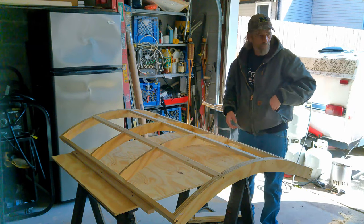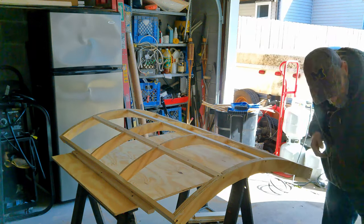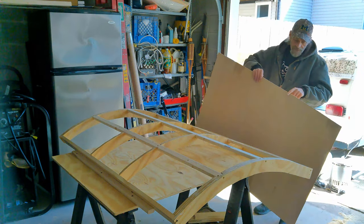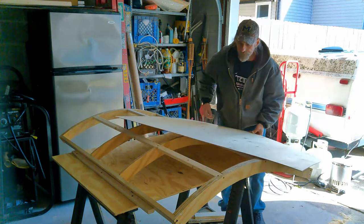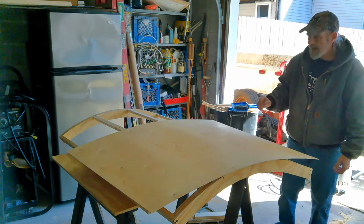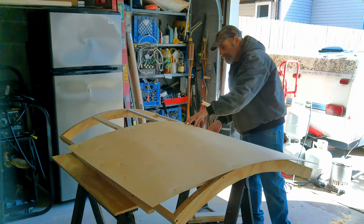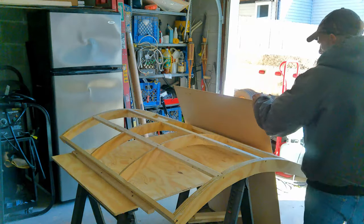What we're going to do now is utilize some of the scrap wood that we had from all these 5-foot pieces that we've cut off. So we have 3 feet left on a lot of pieces. I'm going to grab a piece of the same skin that we used on the roof, you can see it here, and on the ceiling. We're going to take the factory edge, which is this side. We're going to do the crappy side up and the nice side down, so when the hatch is open, you see the nice wood grain. We're going to attach this, covering half of the rib here, so we can attach yet another one on the factory edge and go that way. And we'll just use a router to trim it off. Now I do glue it, but I don't go crazy.